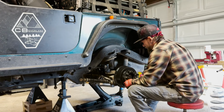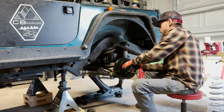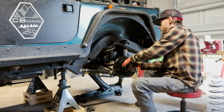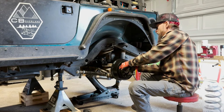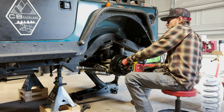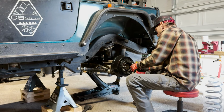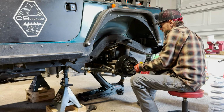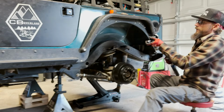So I'll add a little bit of Loctite to the studs and thread these spacers on. Hand tightening these down in a star pattern. I have a bevel on the lug nut, and that'll seat. These are lug centric. I'll seat and make sure that we don't have any odd wobble, but not with an impact. Tighten these on with an impact, you can risk shattering the aluminum too. Give it a crack with all of the jiggadiggas, and torque them down.